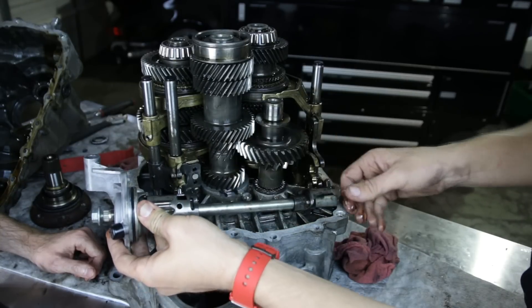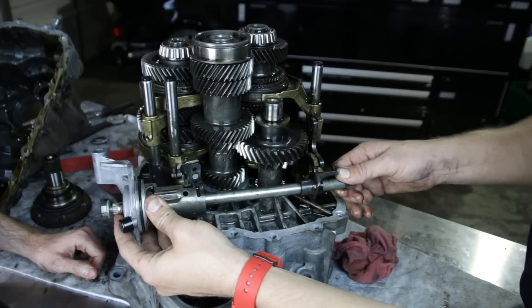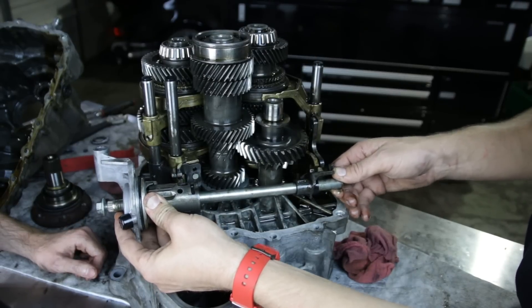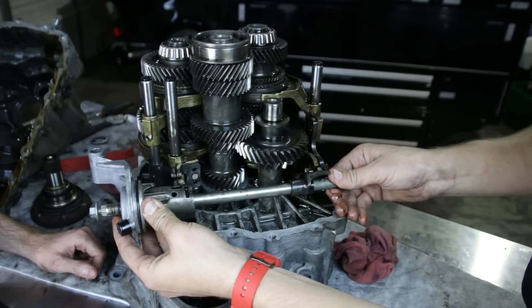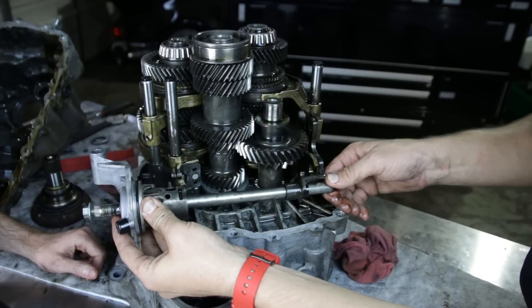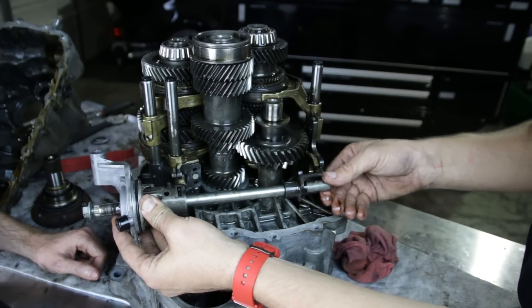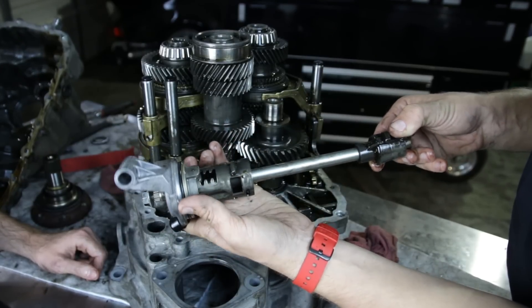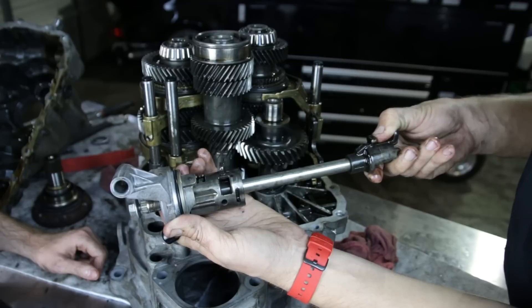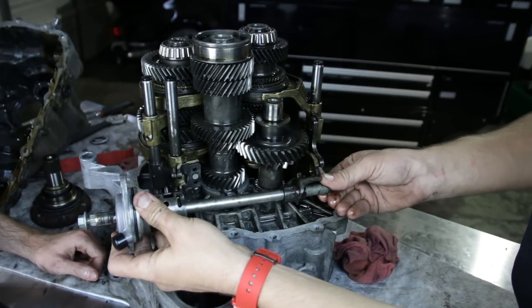There are several different pawls on here. Right now we're in reverse. Moving to the next one, we'll select first and second gear via this one. The next stage selects third and fourth gear. And ultimately, when you move it to the last step, it selects fifth and sixth gear on the other end. There's also a shift gate down in here that helps it positively find which gear you're going for, making it so the shifter can never get in between and engage two gears at the same time.